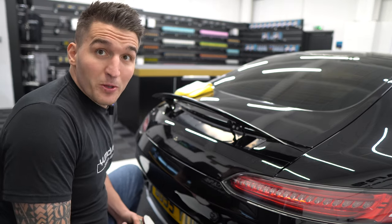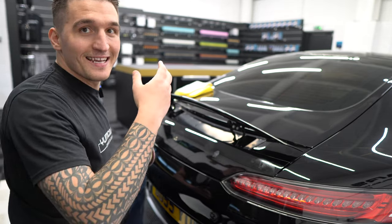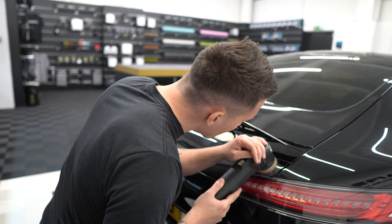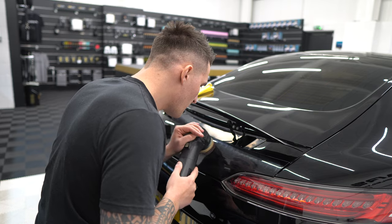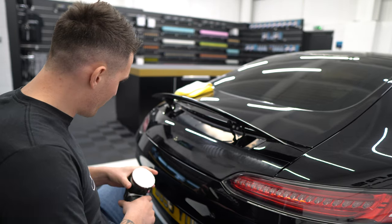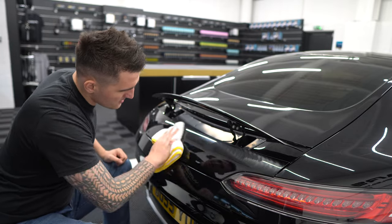I've blown the pad out — you can see that's beautiful. I don't want to focus too much pressure or speed on this part, so you'll see me move left and right on the panel to dissipate heat as much as I can. I can still see a couple of dots — this one's a lot trickier than the other. I'm not sure if it's an aftermarket spray job or not. I'm not going to dwell on it because we're doing a full correctional pass after this. I just want to get rid of all the junk. Done — just had to do a double pass on that.